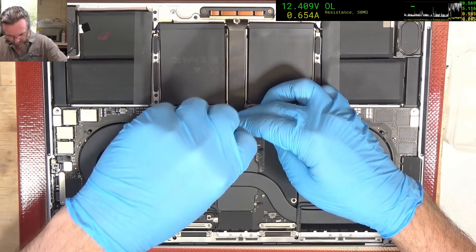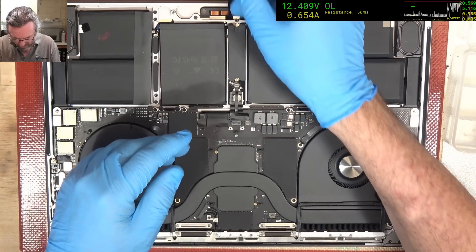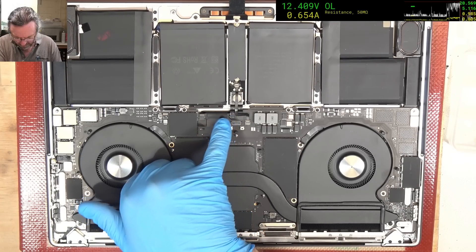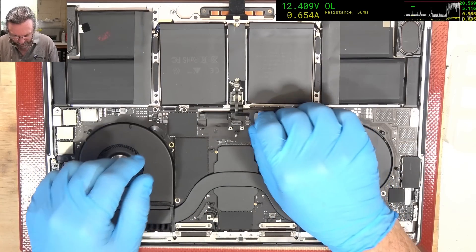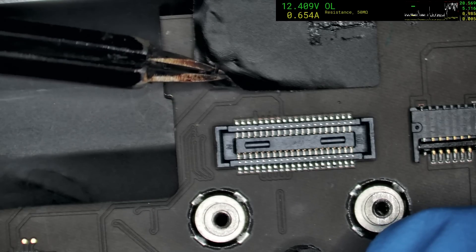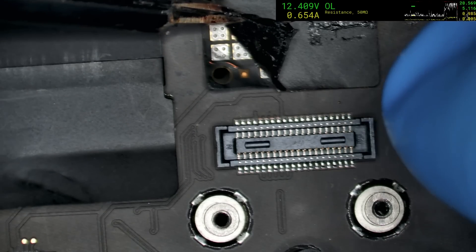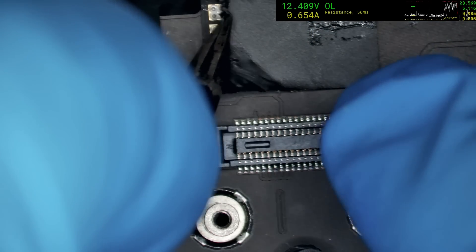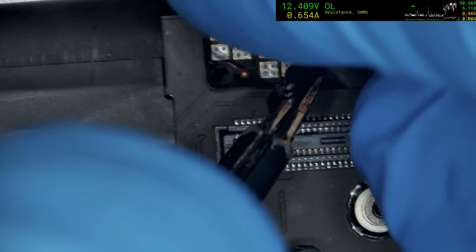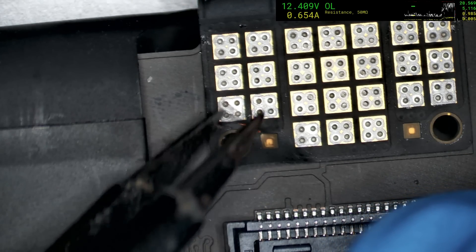Let's have a look at what's been done with the battery. The screws are chewed out — that's not good. It could be that it's just an incompatible battery. Although what bothers me is there's some lifting up of the adhesive here that shouldn't normally happen. They've torn away this flex a little bit from the board, although it doesn't look like it should be enough to cause the issue.